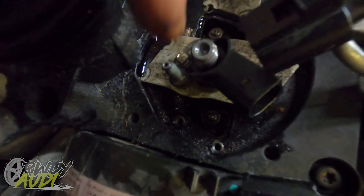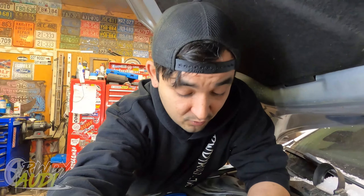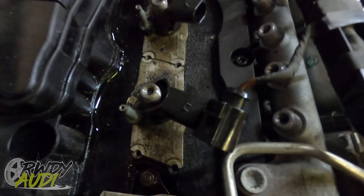There's two 10-millimeter bolts right here. I'm going to warn you about these bolts: if you drop them, they are going down inside of your engine. So be very, very careful — don't drop them, put a magnet on your socket, something to hold them in there. Be on notice. This is probably the more sketchy part of this entire job, so let's get these covers moved.